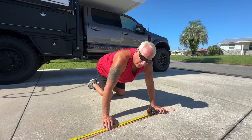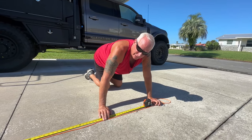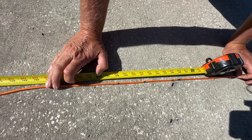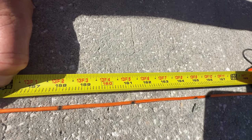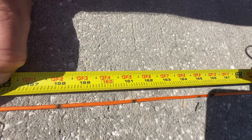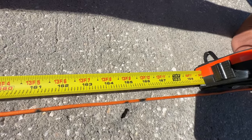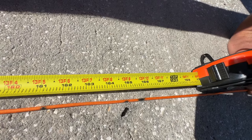What you do now is stretch out the string — the 550 cord — and use your tape measure to read the marks. Our first mark is at 13 feet 2 inches, and that's with the suspension all the way lowered. The next one is 13 feet 6 inches — that's our normal driving height for our host Yukon on a flatbed CM flatbed. So if you ever want to know what your height would be with a host on a flatbed, this is it. The last measurement was 13 feet 9.5 inches, with our suspension raised all the way up.